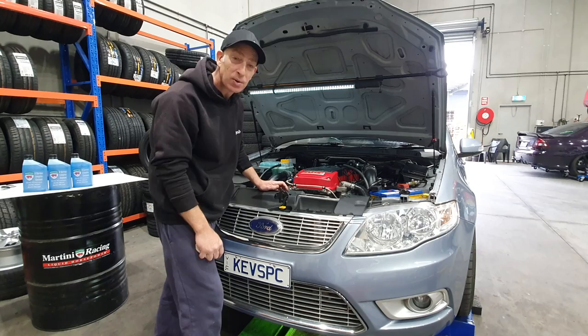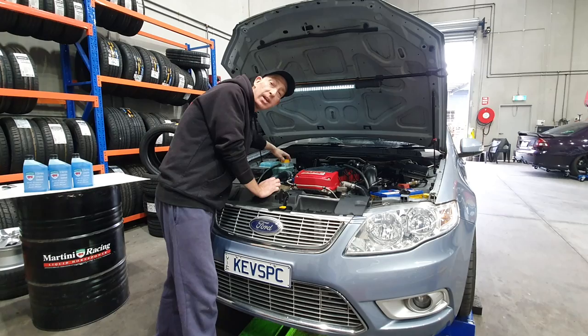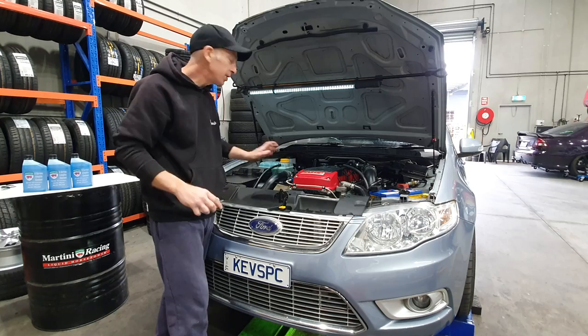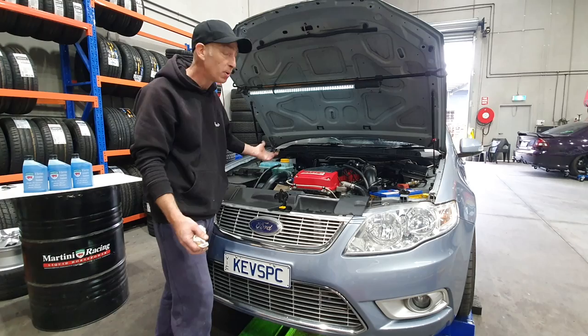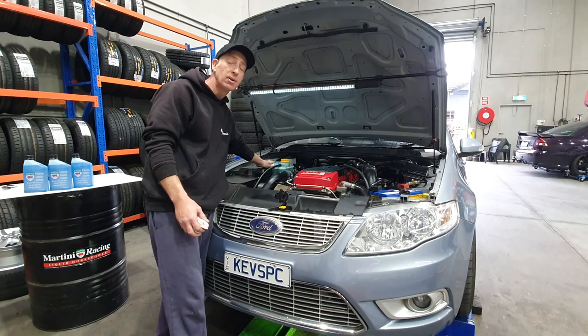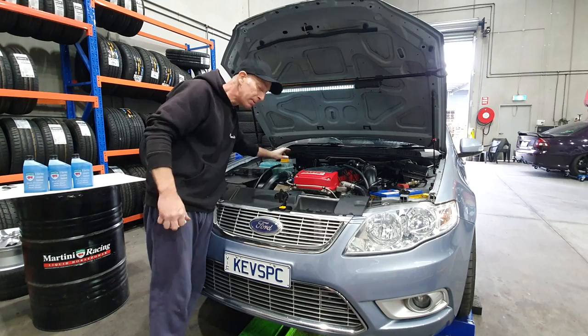I forgot to mention — obviously before you drain the cooling system, crack your radiator cap. Never crack your radiator cap when the system's boiling hot. This has been sitting for about 10 minutes, so we'll just undo the radiator cap, which relieves any pressure that's in it. Also, I see a lot of Falcon engine bays that are really nice and clean, but with a dirty old original header tank. These are only $50 at your local Burson's. I got mine at trade price for about $30. It makes a huge difference — looks a lot neater and cleaner in the engine bay. So whenever you're doing a cooling flush, maybe spend the extra $50 and get yourself a new header tank. I highly recommend it.